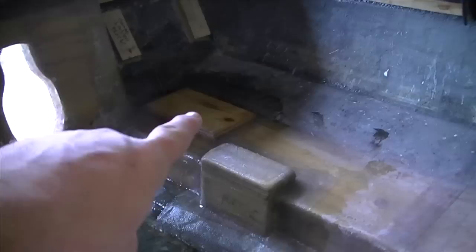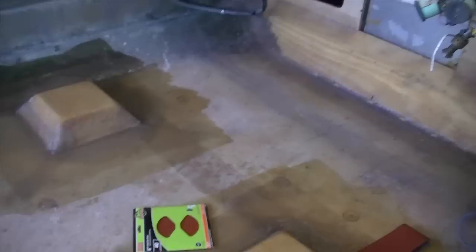You see my trim pump mount and my battery mounts back here. They're all glassed in, ready to go. So all we need to do is really clean this out good and get it ready for gel coat. As soon as it comes in, we're going to put 2 layers of non-waxed down, and then we'll put 1 layer of wax down. If you look closely here, you'll see in my little kick plate there are 4 or 5 little white things. Those are my drain holes.